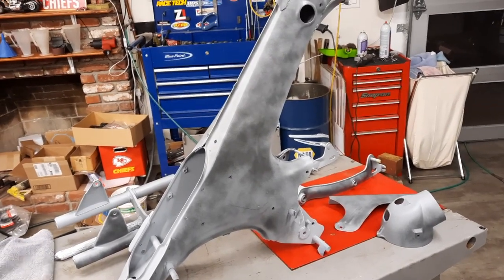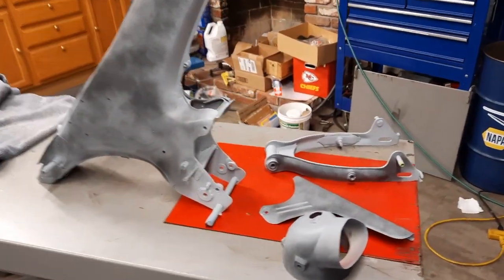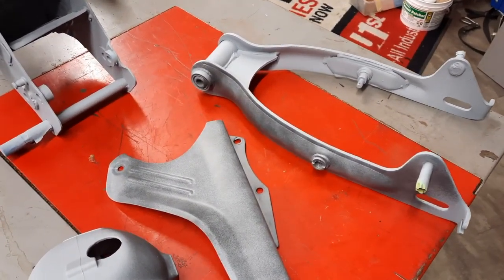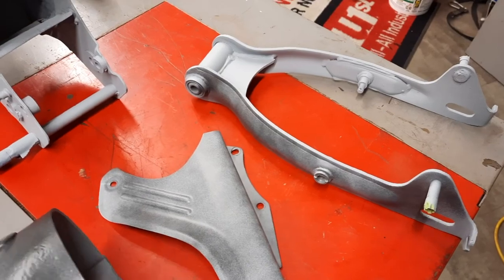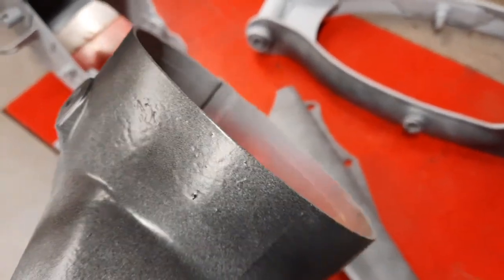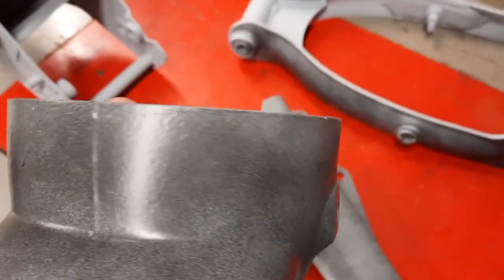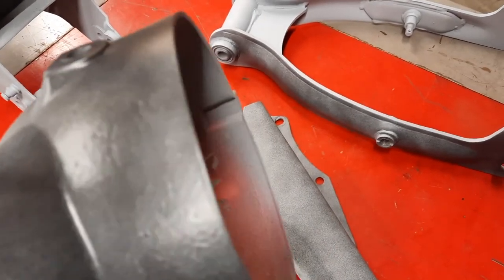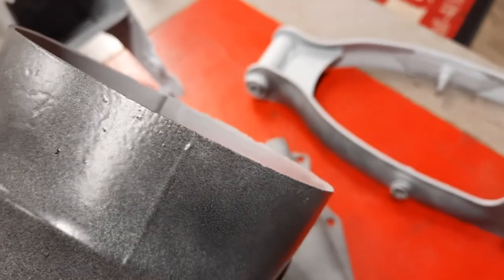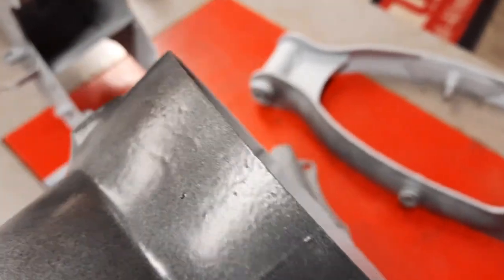I'm going to try to keep the segments shorter. Here is everything out of the paint booth and ready for an initial sanding. I can already see how this high-build primer might just do everything I need without any filling. I'd hate to fill plastic. With this guide coat I'll probably have to sand this and then maybe do three applications - maybe three, four, five coats - to finally get the primer to build up enough to take out these sun blemishes.